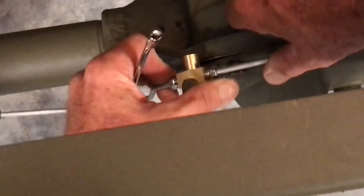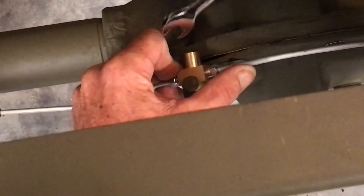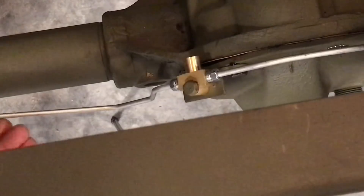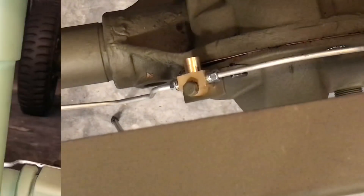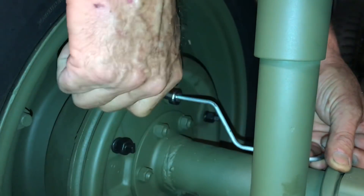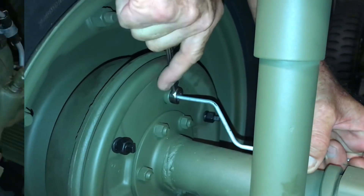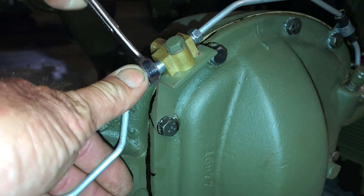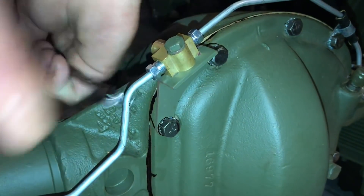Go back to the brass T with a wrench and tighten the bolt securely to the bracket on the differential cover. I like to start with the center T and work my way out to the brake cylinders. Use a proper flare nut wrench on the fittings — you don't want to round off the corners or twist and kink the tube. Use your opposite hand to secure the line as you tighten. My rule of thumb: run the fitting down until it bottoms out, then get an eighth to a quarter turn to make a proper seal.